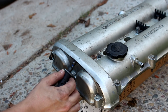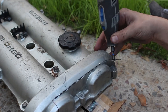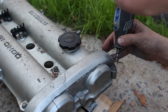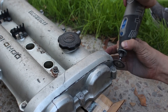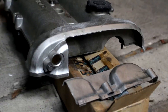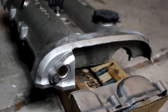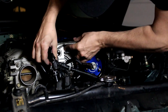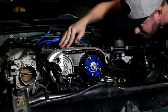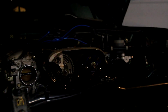There are several different ways to cut your valve cover — if you Google 'Miata valve cover cut' you can get some inspiration. My cut is going to look a little funny so I can leave that NB1 cam sensor in place — not the most beautiful way to do it, but the most functional if you have a BP4W. I'm actually going to keep my cutout piece, thinking about doing something where I could bolt it back into place and have it look almost factory. There seem to be very few issues reported with valve cover cuts as far as getting dirt or rocks in there.